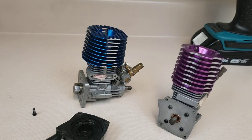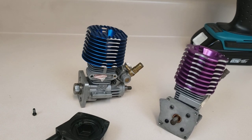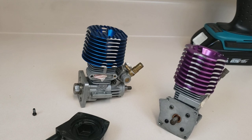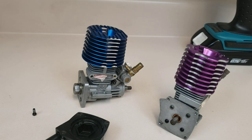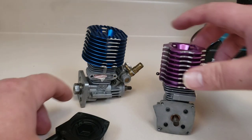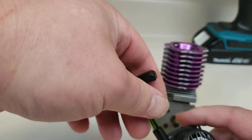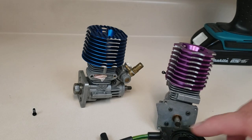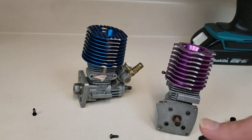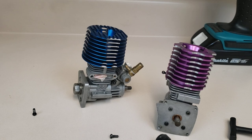To summarize how to drill start without screwing it up: use torque settings, pay attention, don't flood it, and make sure you're spinning it the right way. I've seen people put the one-way bearing on backwards and crank forever wondering why it won't run. Just take the one-way bearing off, spin it around, change direction on your drill, and try again. Most of these engines rotate counterclockwise. If it sounds funny or won't start in one direction, you might have the one-way bearing in backwards.